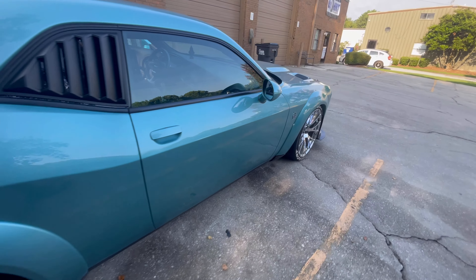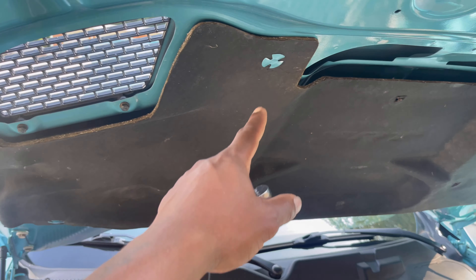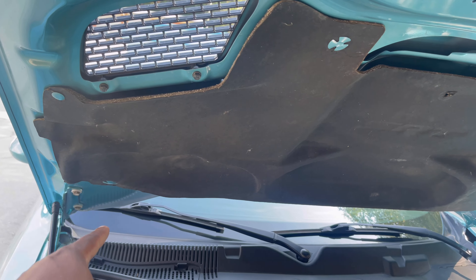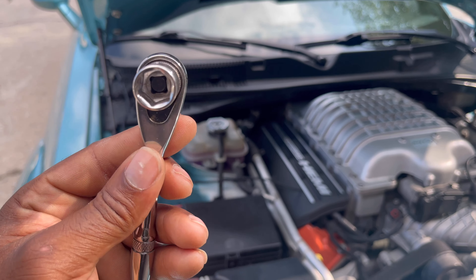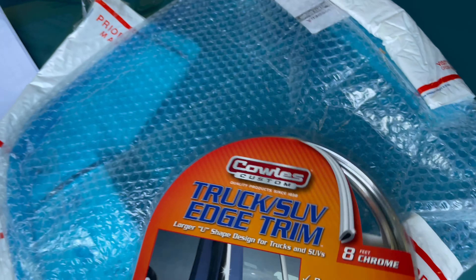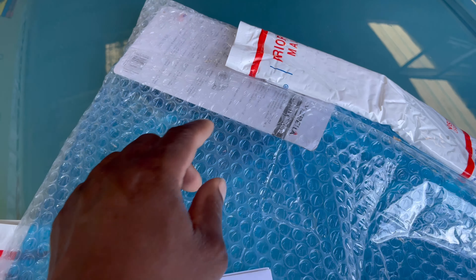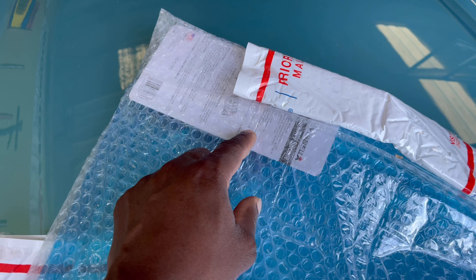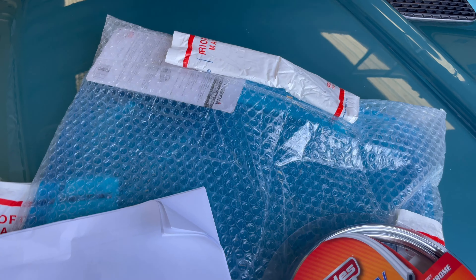We're about to go in and knock this hood out. So the next clip y'all will see will be the install. First thing we're going to do is take this heat shield off, popping those off. About to take the hood off with a 13mm socket. He's going with the chrome because he's got chrome on the car. I'll leave the link in the description for the glass. It comes with this template and also comes with some heat resistant silicone, but I got some glue that I'm going to use — you don't want to just put it on with that, it's going to fall off.